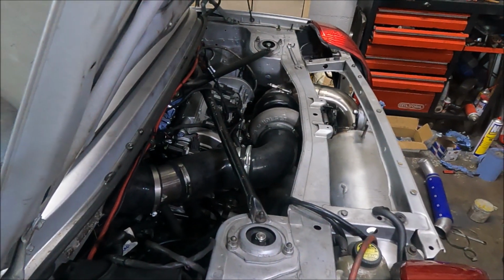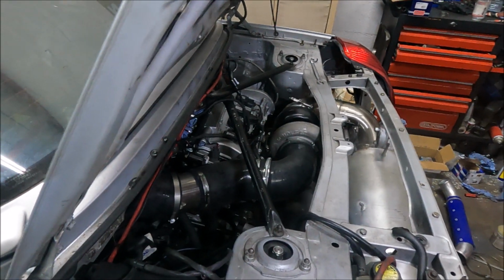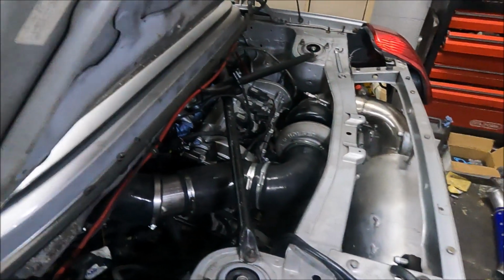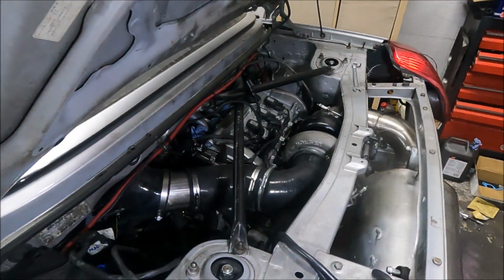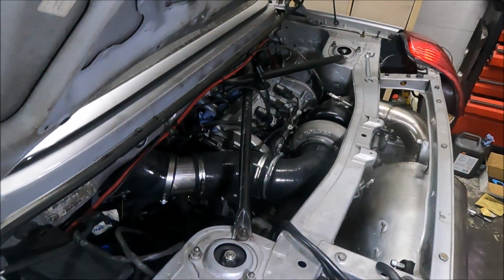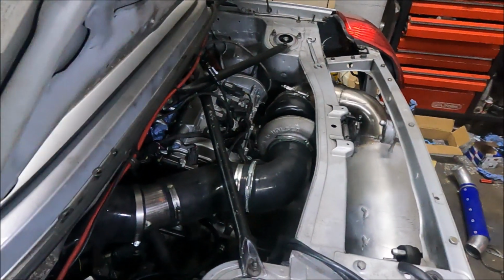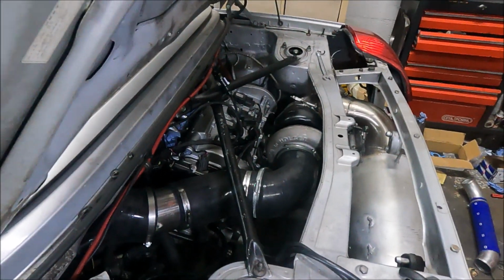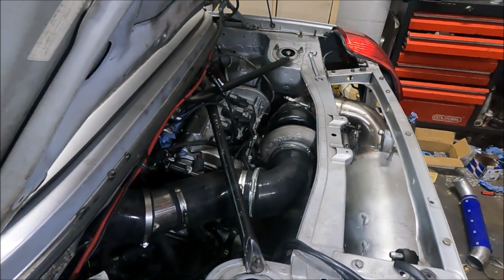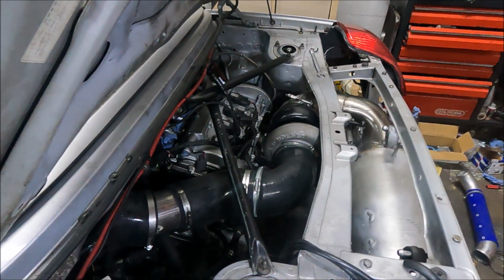You know, it says 19mm plus. It's not hard to get a flange that's too small and drill out the hole or whatever. So that's what I always do. I was a bit concerned on this that the hole back into the sump wouldn't be that big, but honestly, I think it's like 18.5mm, which is pretty much spot on. But the original oil return is way smaller. It's like not even 15 if I recall. It's like 10, 12, it's tiny.